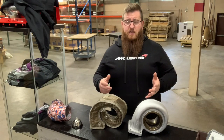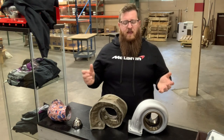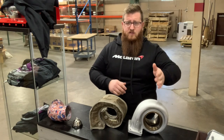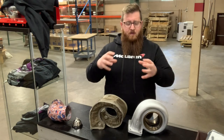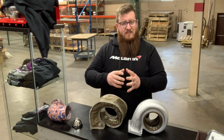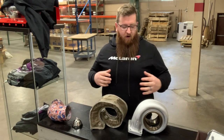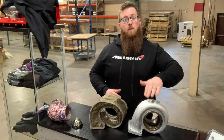Now on the compressor side, you want just the opposite. You want those air molecules to be as closely and densely together, and when things get cold, they shrink up. That's why on the compressor side you have a charge air cooler — an intercooler — because you want that air to become more densely packed for better combustion. But going back to the exhaust side, you want those molecules to be as far apart so you have more air driving the wheel more quickly.